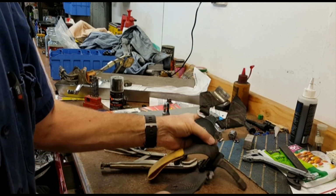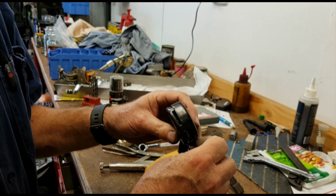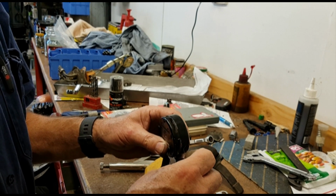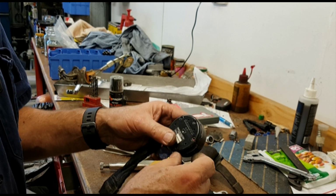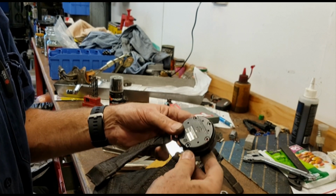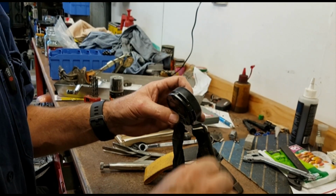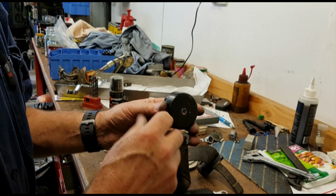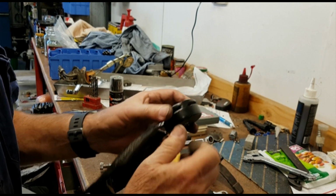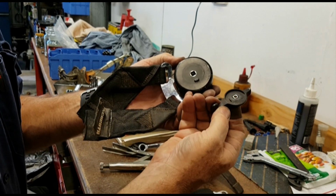So at the end of the day, the fault appears to have been that in the course of the activity, a small rock has somehow managed to get jammed in there, and obviously with the occupants pushing on the belts trying to get them in, they haven't noticed the small rock. The rock has actually been pushed down inside the housing, and it has stayed down in there, and when they've tried to release it, that small rock has jammed up, and then in order to try and release it, they've put more and more force on it, which has resulted in the shearing off of that square peg.